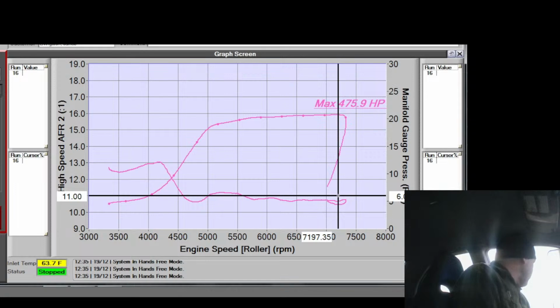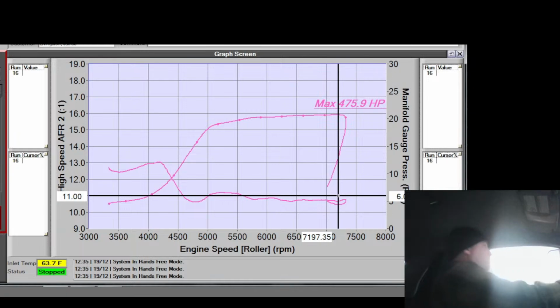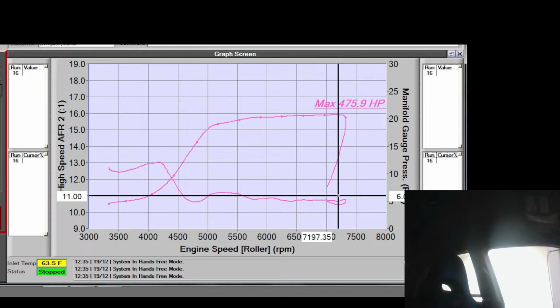So do you wanna get some wrenches? Yeah. We gotta do the return though because I can't just turn the pumps on with this one. I have to run the engine, so it's gotta be the return off the regulator. Really? Where's the regulator on this? Right there. Oh, so it's the same thing. Just pop that return line off and jam that in the return line. They're hose clamps. Because it's an early car, that's why. So there or down there. But I think we should be able to.